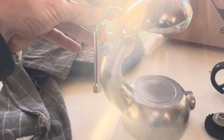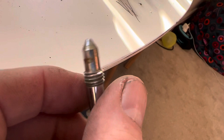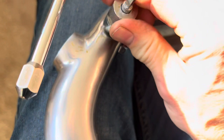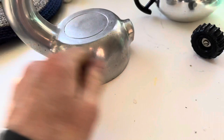I'm pretty certain on a genuine Atomic this would be a brass rod, whereas here you can already see the first signs of rust, which means it's probably plated steel. We've tightened the fitting so the arm is in the right position. Once you've screwed that fitting in, you might need a watchmaker's screwdriver to push the gaskets all the way down. A lot of people don't realise you can still buy genuine Atomics from Bond Trading in Sydney — not at the moment due to supply chain issues — so there's no need to overpay for a second-hand one on eBay or buy a replica.